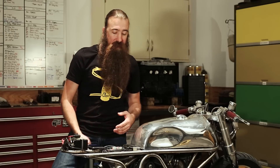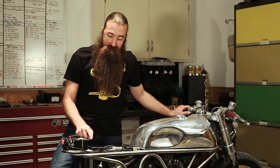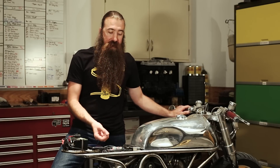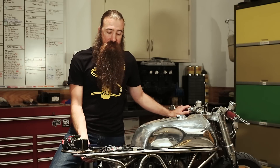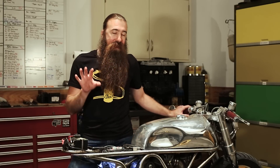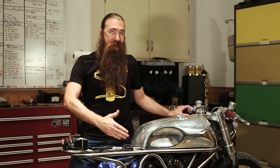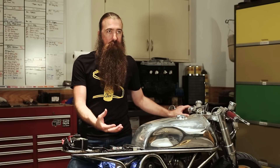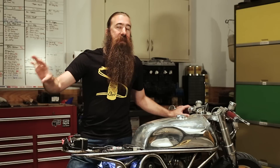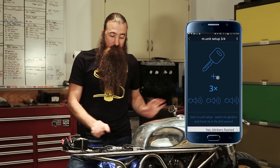J63 has an ignition switch because it used the old M Unit, so we'll just turn that on. The important part here is you need to honk the horn button three times within the first second of turning the M Unit on — this timing is really critical. I'm going to go ahead and turn this on and immediately do three button clicks on the horn button. If you get the timing wrong and wait longer than one second, it will actually honk the horn — that's a good indication you did not enter the setup pairing menu. Honking the horn three times after initialization enters a different calibration setting menu, which is not what you want.